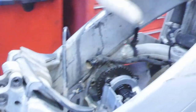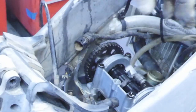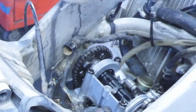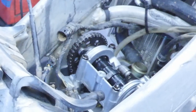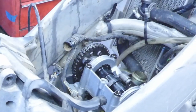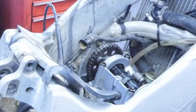You'll notice this valve cover's off because all these have tight valves. So we went ahead and checked the valve adjustment. We're waiting for an O-ring for the top cover before we put it back on. But all these older Hondas, you have to check the valves — they all have tight valves. Don't do a carb clean without pulling the valve cover and at least making sure you have clearance on every valve. This one did, so we don't have to do anything.